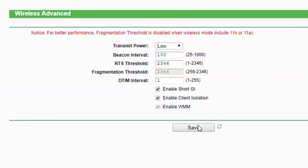That wasn't too difficult. You're going to want to log in and change the default admin password. Then search around — in this one it was labeled Wireless 2.4GHz; it could be labeled Wi-Fi. Not all boxes have this option — you may have to check the manual. If you're buying a new one, you may want to download and check the manual before you buy it to make sure you can actually lower the power.